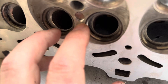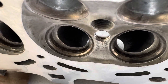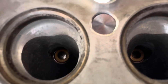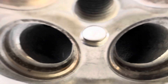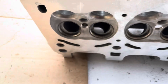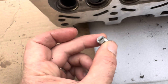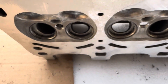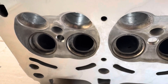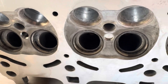The same issue exists with the DI delete plug. There's a DI delete plug fully installed in this hole, and you can see the same problem — sharp edges of the thread left on either side, top and bottom. The DI delete plug is just a blank plug. My intention is to do the injector bore repair kit now while the head is off because of the corrosion, and later, if I choose to go DI delete, I can unscrew the inserts and screw in the delete plugs.